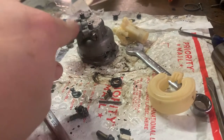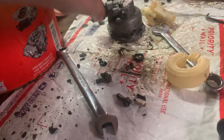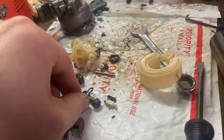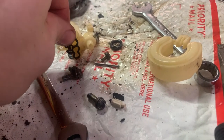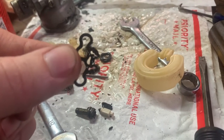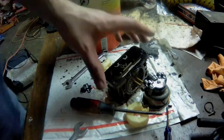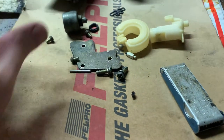I'm just gonna clean this out and spray it with some carb cleaner instead of soaking it since I can't get this off. One thing I noticed taking this thing apart is there's a gasket right here and this gasket was on backwards. If you look at this you can see where it's supposed to seal up - well it was put on the other way. Somebody's been in here before me and they put that gasket on backwards - it smashed that gasket to pieces. I got everything clean and I'm gonna be real careful with these gaskets.